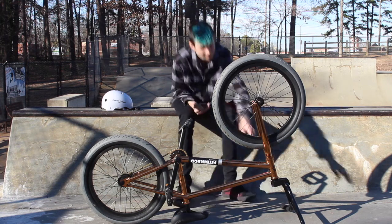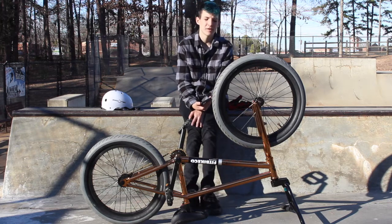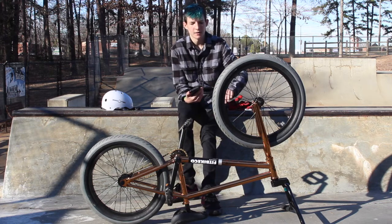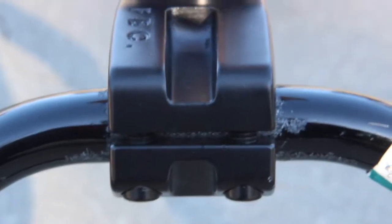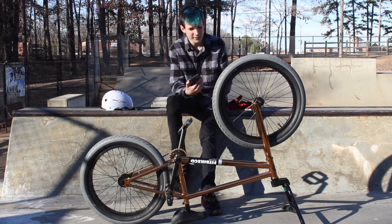The bars — whenever I first got the bike, just like with any new BMX, it's going to start slipping because it's not broken in yet. It hasn't rubbed off the paint or clear coat under the clamp — it's not metal on metal yet. I had to get a rock and literally scrape off the paint because I was out riding and I wasn't going home to break it in. I was going to ride it now. That was not fun.